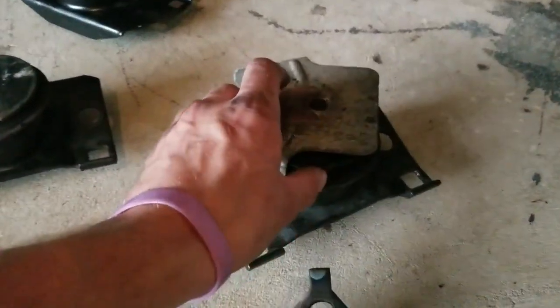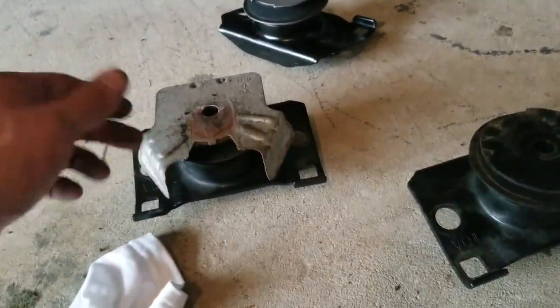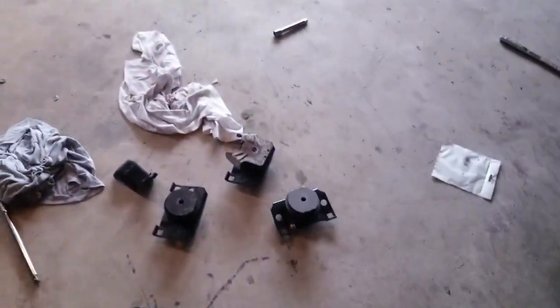What I did is slide it out. The only issue I ran into was getting it back in — the shield has to go back on right when you're sliding into that tight spot. In the limited space with the shield and the steering linkage right there, I slid the mount all the way out, set the shield back on top, and then slid both of them back together. I wish you could just set them out and slide back into place, but there's not enough room — it's like a jigsaw puzzle.